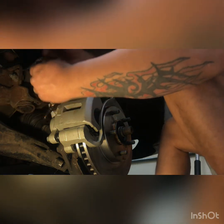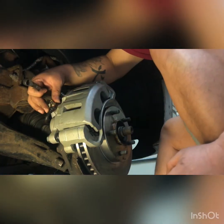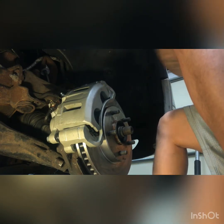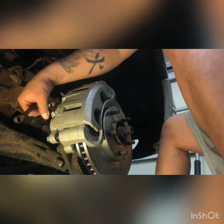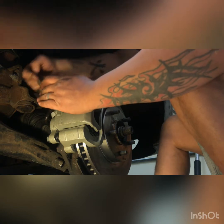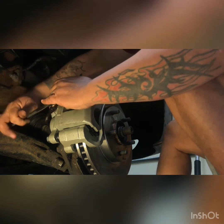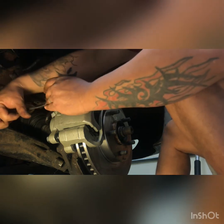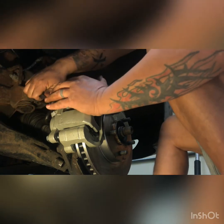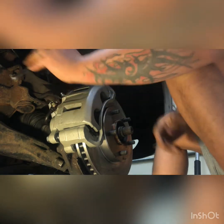So lucky us, this is still a number 11. This caliper actually has a notch in there, and it will tell you which way this line sits. So you can see it only moves this much, and that's what you want. You want to put it in the notch because that's where it needs to be, right? And then we're gonna just cinch it down real good. Yep. And that banjo bolt's really special because it's got a through hole, and it allows fluid to move through the bolt.